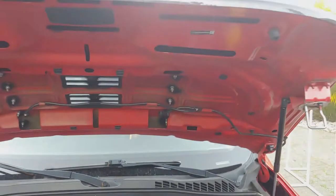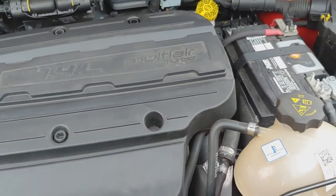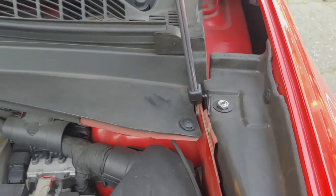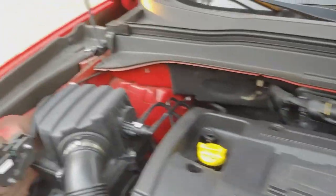I had the prop rod in there since there's no normal hole to help hold up the hood while changing out the lift struts. I really like this mod, and I like it even better now that I have the rain gutter foam being held in place — there's no longer a gaping ragged hole in the foam where the original clips used to be.